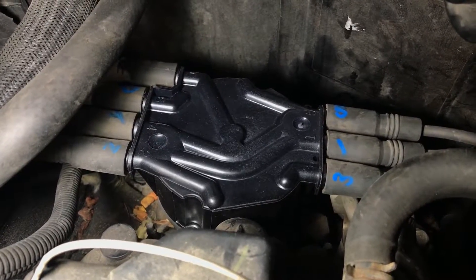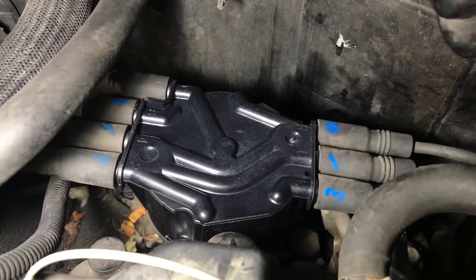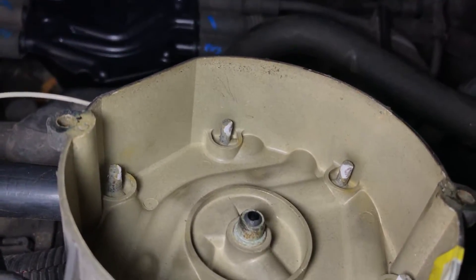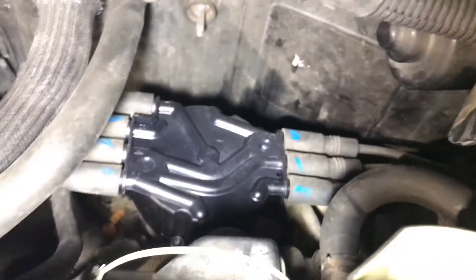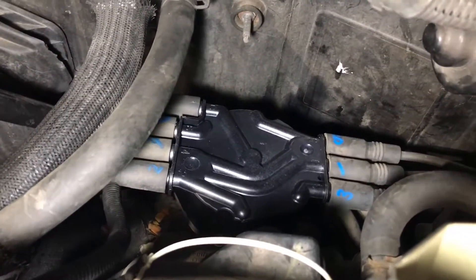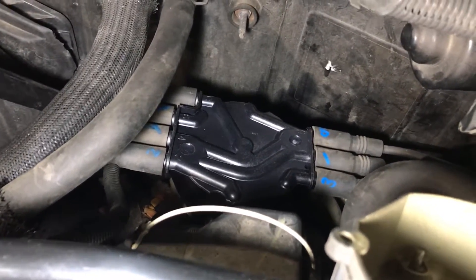We got the new parts back on — labeling the wires made it super easy to put them back in the right spots. I did have corrosion on my distributor cap and my rotor; that part actually just fell apart when we touched it, so those two things were definitely probably part of my issues. Now we're just going to wait and see if it does it to me again. Thank you for watching our S10 Life YouTube video, and stay tuned for next time.